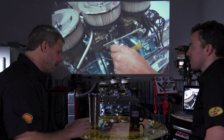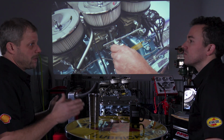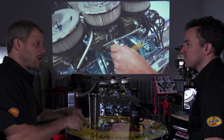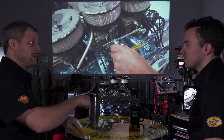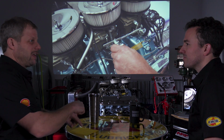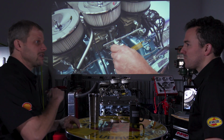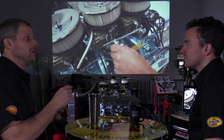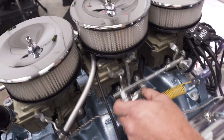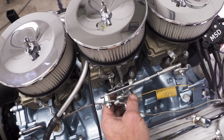And this particular camshaft is what they call a 4/7 swap. Instead of the normal firing order, you swap the firing order, so cylinders 4 and 7 swap when they fire. What they found is that by doing that, the engine tends to run a little smoother and actually makes more power. You get some exhaust scavenging that's a little bit better, and it flows more air through the engine.